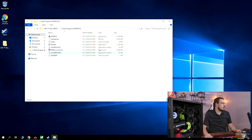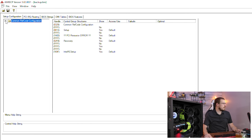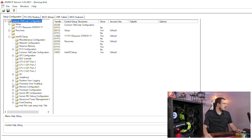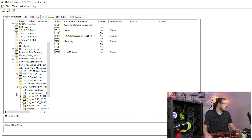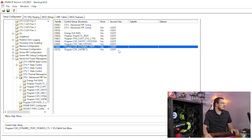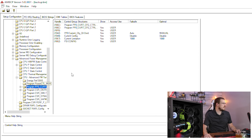Using the same download as the last video, we're going to open up the AMI BIOS utility and open the backup copy of the BIOS. First, we're going to open up the root folder, go down to Intel RC Setup, go down to Advanced Power Management, and then open up the CPU Advanced PM Tuning. Inside of here, we're going to set all of the access and use to user — that is, unlock them in the BIOS, as the default permission set denies you access to these folders. Then we're going to open up the PPO program and do the same thing with all of the menu options, setting them to user instead of default. Once you have those menu options unlocked, you can go ahead and save your BIOS and close the AMI BIOS tool.